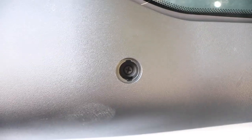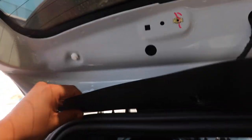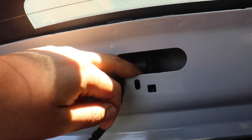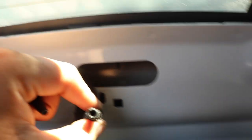You want to go ahead and pop these right out, then get your Phillips and take those two screws out. Once you unscrew them you can pull this out — there are like two push pins you have to pull out to take this panel out. Right here this line — that's where the washer fluid goes. So you're going to want to grab this that comes with the kit.